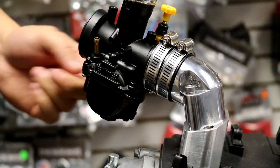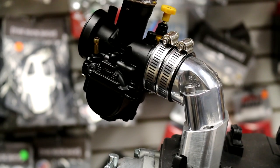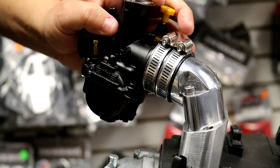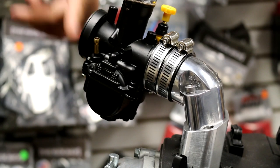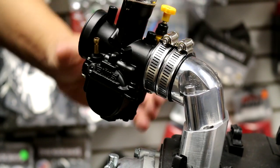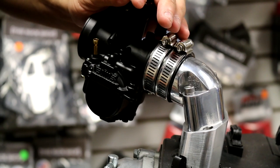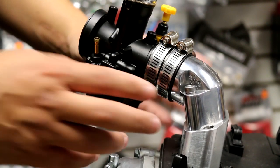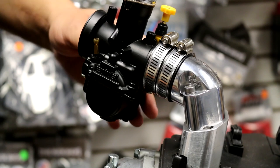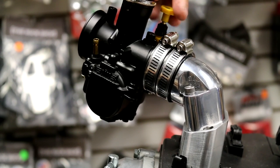Either you start it or blow into your tank — you need to get fuel back in here. Take it for a test ride, see what happens, and repeat the process. That's pretty much it — it's very simple, but it's something that a lot of people do not do. That's what's going to either stop the overflow, or if you have not enough fuel at wide open throttle, you may have to allow more fuel. If you have a big bore kit such as a 232cc and go all the way down and it's still not getting enough fuel, there are other fixes — we have an extended float bowl that holds more gas. On the big 232cc motors they consume more fuel than the pump can put in, so we make an extended float bowl for this, also for the Mikuni and the OKO30. But for most people running 171s, this is how you fix the problem. Hope this helps — like, subscribe, put any comments, and if you have any other questions feel free to email us. Thank you for watching and have a great day.